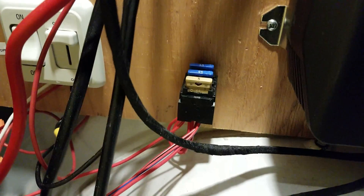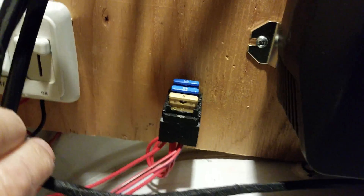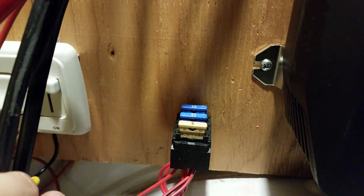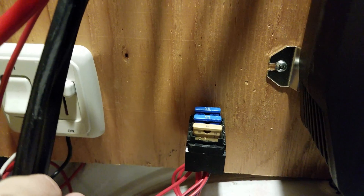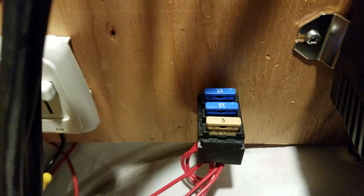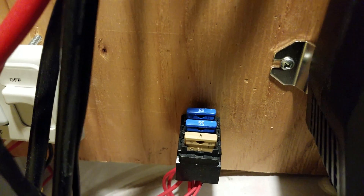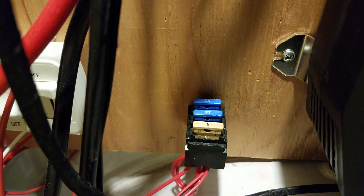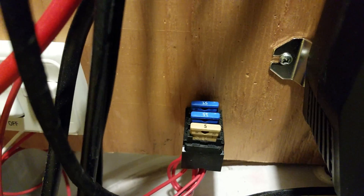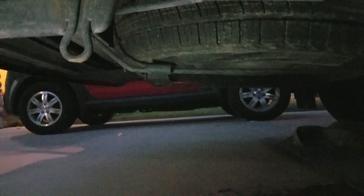Along with installing the controls, I had to put in a separate fuse block — the instructions say not to tie it into your main fuse box. It comes with this little box you have to build; it's a little annoying but just follow the directions and look at the diagrams closely. You've got two 15-amp fuses and a 5-amp for the pump, controls, and blowers. It says not to add any additional switching — I wanted to tie it into a switch to shut the whole unit off at once, but they say don't do that, just use the off switch on the controller.